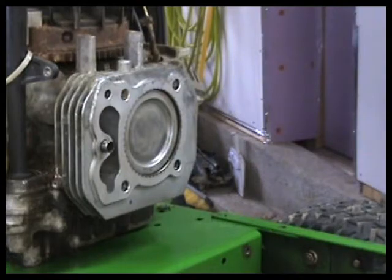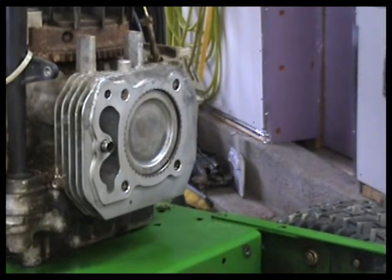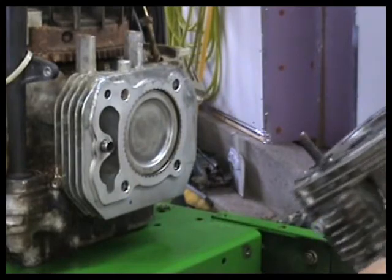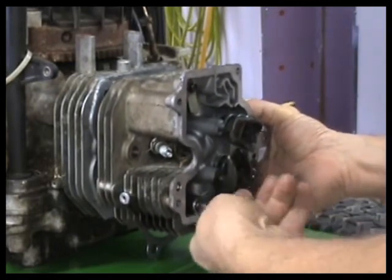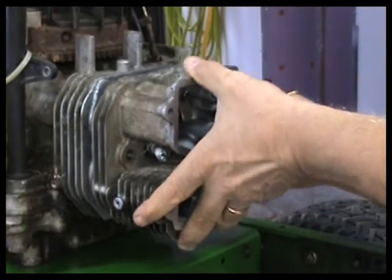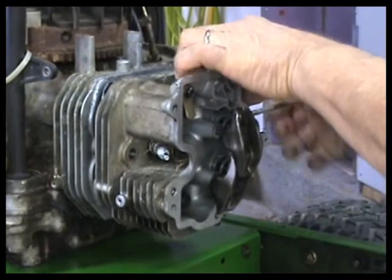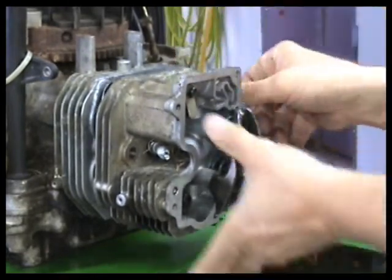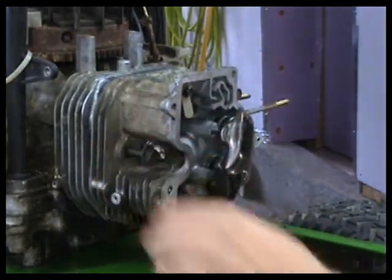I'm gonna take our bottom bolt, which will go here, because the gasket is on the dowel here, but it's the only one. The other dowel is actually on the engine. So as far as holding our gasket in place, I put a bolt through, like so. Start our bolt. Get a second bolt. Put the gasket up into place. Notice how the gasket just flops down. Get our second bolt started. Third and fourth.